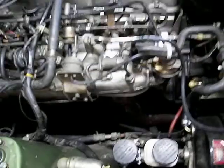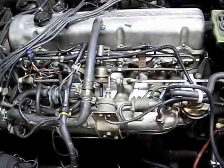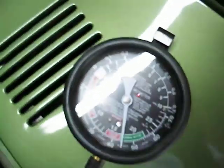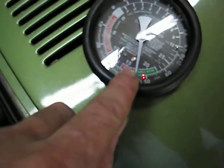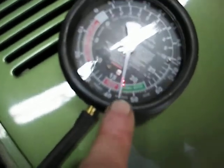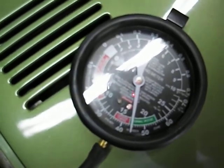This is my Z. I've let it warm up — it's down around 800 RPM. I'm doing the vacuum check, so I want to see how I compare to men's readings. I'm at about 15, 16, 17 — about 17 and a half. And you can see the needle is pretty rock solid.